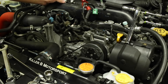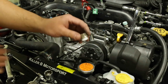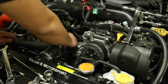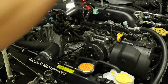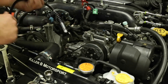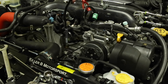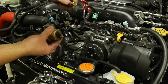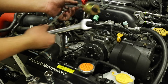The next thing you're going to want to do is get your adapter that you just bought that has the NPT threading and go ahead and put it back on. Once that's on, get your hose and just thread it down. The hose is now installed. Get your oil pressure sensor and just attach it to the hose. There we go — that's with the oil pressure sensor on.